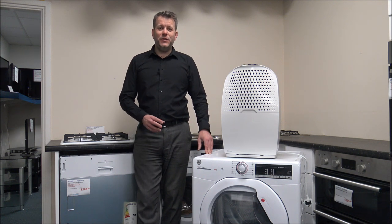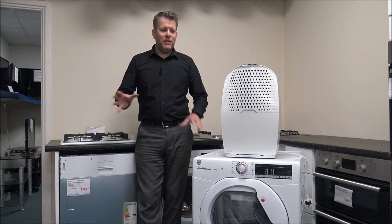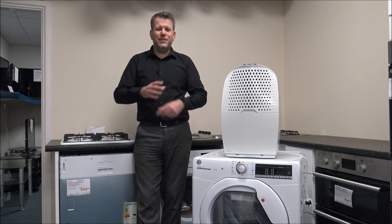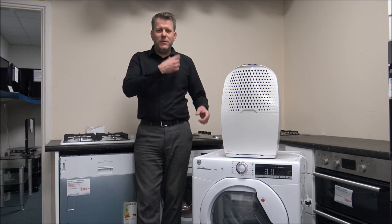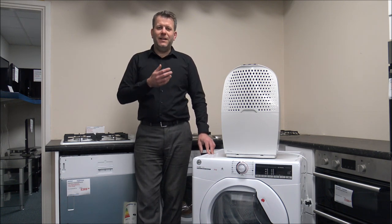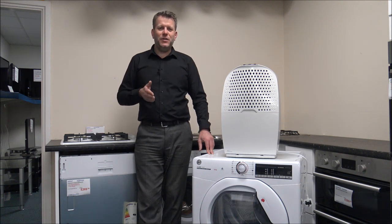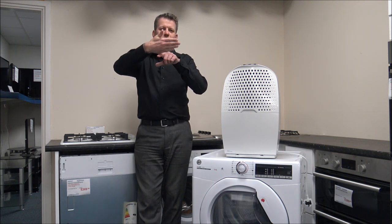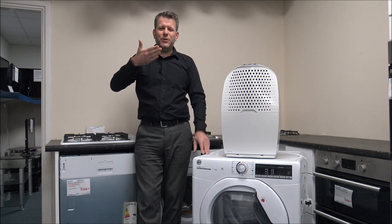Number eight: don't overload your washer. When it comes to washing, I know it's always tempting — you've got all your wash in there and you think, let's just cram in that last shirt or blouse. The main downside is that if you have too much in there, it won't spin to its full extraction rate and you won't get the best performance. What you should be able to do is put all the clothes in and still be able to put your hand in on top of the clothes. Ideally you don't want the washer more than about two thirds full.